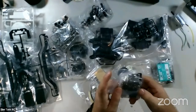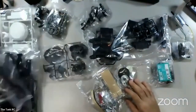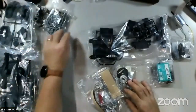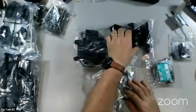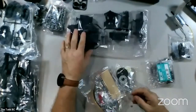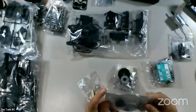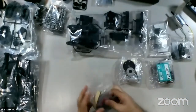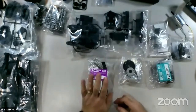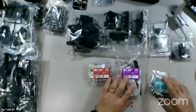I took my 3600s and I drained them, and it took longer than it does for you guys to go through a pack in crawling. You think? I was using 380 motors on both the things. It took more than 4 hours to drain them completely. Wow. That's longer than you guys doing crawling or trail running with your 5000 pack. They're 3600 NiMH. And I was just letting them free run off the battery to drain it, because for all those years I was using NiMH. They say you need to drain them. They can't sit with power in them. You got to have very little left in it. It's the opposite of what you do with LiPos and the lithium batteries.